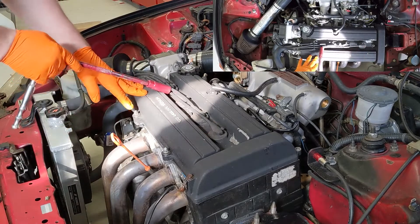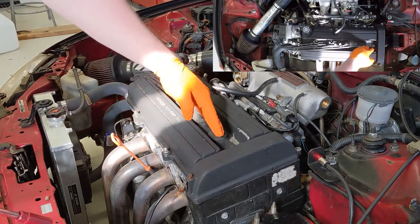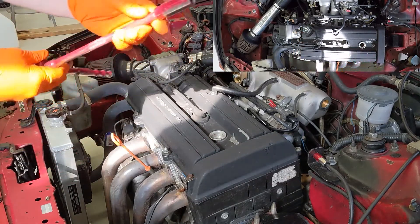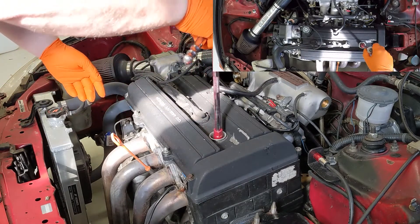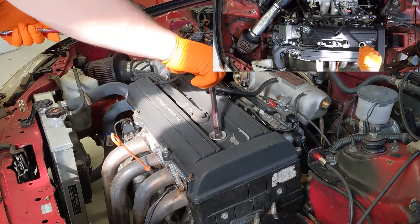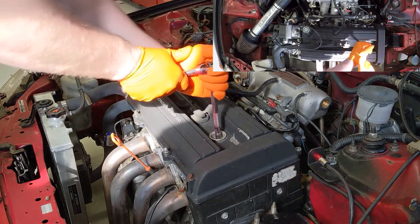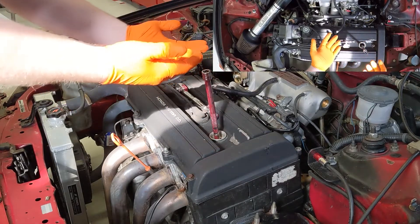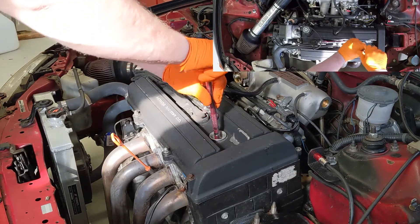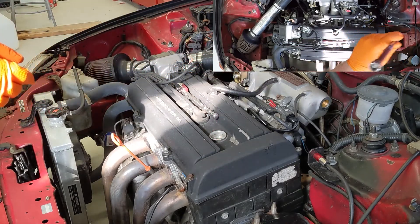Out of the Del Sol we've got our four plugs running right across the top. This is a dual overhead cam motor so we've got our intake cam back here and our exhaust cam on this side with our exhaust manifold. The plug is going to run right down the middle in between those two cams. We pull the plug wire out and use that special socket with the rubber grommet, making sure it seats on the spark plug. There are a couple of different sizes — it's easy to tell if it's slopping around. Very carefully crack this thing loose and keep the extension as straight as possible. A lot of times you're dealing with a steel spark plug going into an aluminum head, and aluminum is much softer than steel, so if you over-tighten or put the plug in crooked you can destroy the threads on the cylinder head. The plug came out and stayed in my socket, which is exactly what I was looking for.